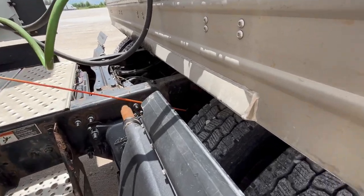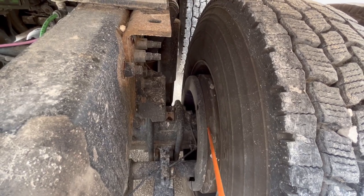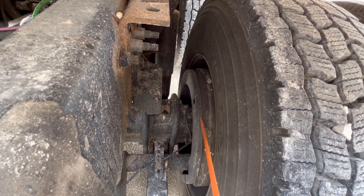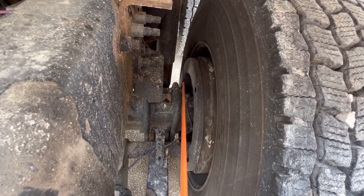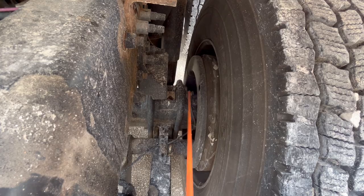As we move back in here, we're going to check our brake drum. Brake drum is properly mount secured, not cracked, damaged, or missing. It's free of any oil or grease residue, which would cause failure. Then we're going to check the brake shoes — make sure they're properly mount secured, and there's no less than a quarter inch thick pad left on the shoe.